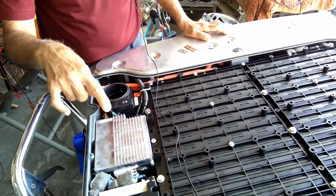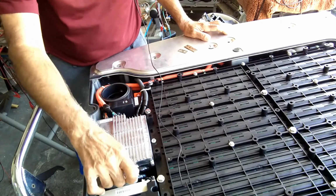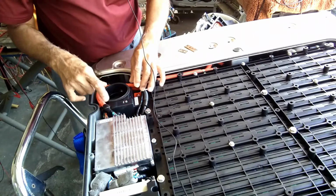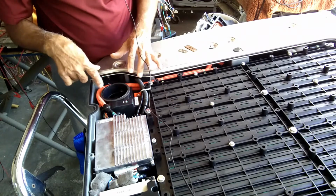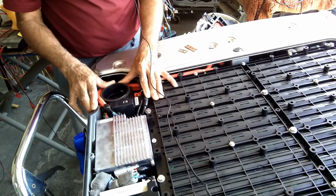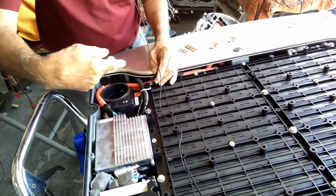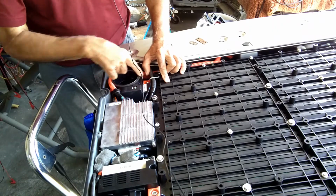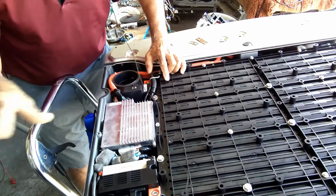Now the easiest way to remove them is, first you remove the BCM. There are about 5-6 bolts you have to open, and all these connectors have to be removed, and then take this out. Once you remove the BCM, then you can start removing the housing for the safety plug. Again, you have to open about 5, 7, 8 nuts, and there are a lot of wires and connectors, and then ultimately you have to push this to this side and push it out, because it has built-in U-shaped connectors which go into these posts. As you see, there's a post here and a post here, and then there are 2 posts at the back, at the bottom. These 4 posts are big orange posts, and I will show you more clearly in the next video.